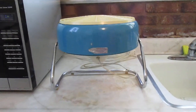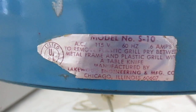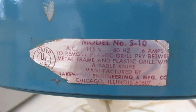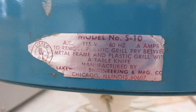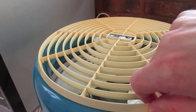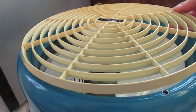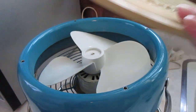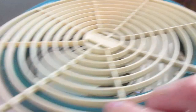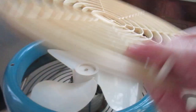Now I'll show you the sticker with all the information. It's a little torn, but you can still read it. It says that you can use a butter knife to pry the front grill off, but you actually don't even need that — you can just take it off with your hand if you're good enough. It's only held on by these little plastic tabs that insert into these holes, and you can see one of them is broken off. That's a common issue with these.